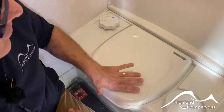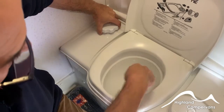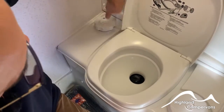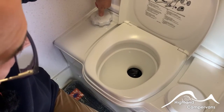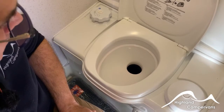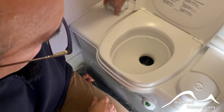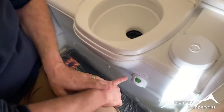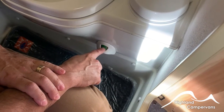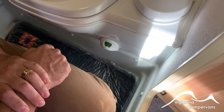With the toilet cassette seat up, open up the lever on the left hand side and it opens up the wastegate in the bottom of the bowl — let your waste go straight through and then it's an electric flush. This flush works in conjunction with the pump switch so you'll see some pink rinse water going around the inside of the bowl. Use as much or as little as you feel you need, then close over afterwards. As the cassette slowly fills up this gauge tips over from green towards red. First time round, let it get about half full just so you can gauge the weight — when they are completely full they are quite heavy.